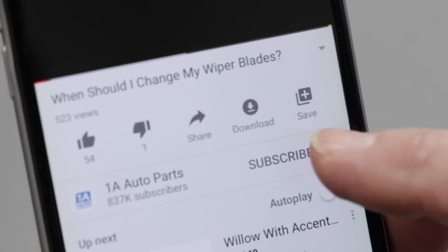We tried to make you a nice informational video about different places you can look for exhaust leaks on your vehicle, aside from the regular check-your-muffler, check-your-mid-pipe situation. If your vehicle's cold and you start it up and hear a ticking noise that goes away after the engine's warm, more than likely you have an issue up by the manifold — whether it's a crack or an issue with the gasket between the manifold and the engine. If you need any parts, you can always check us out at 1AAuto.com. If you liked the video, please smash the like button, comment, and subscribe — it would mean the world. Thanks.